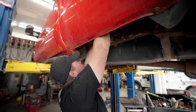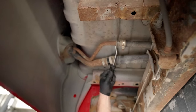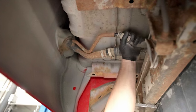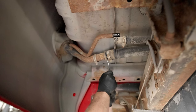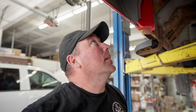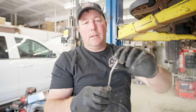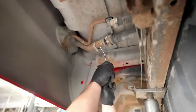I'm pretty sure these hoses have been on here for 24 years. What I'm doing here is using a pick to get between the hose and the metal part to kind of break the hose free — they've probably been on there for 24 years and it's a bit of a fight. These hoses usually get pretty stiff, old, and brittle. The end is actually a little sharp; I usually like the end a little blunt because if you're not careful you can pull that tip right through your hose and then have a leak, and that sucks.